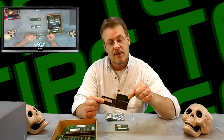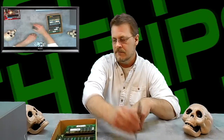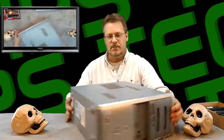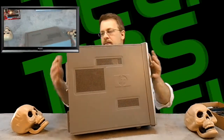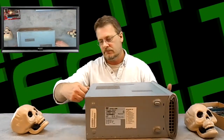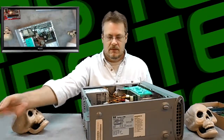I just wanted to show you what RAM for a desktop looks like versus RAM for a laptop — it's about half the size. Now I'm going to show you how to open the computer. Each computer will vary, so please consult your manufacturer's instructions. Today I'm going to be opening this HP. Most computers open up on the user's left side — here's the front and this would be the left side. Most have a thumbscrew on the back that you twist, then pull the cover open.